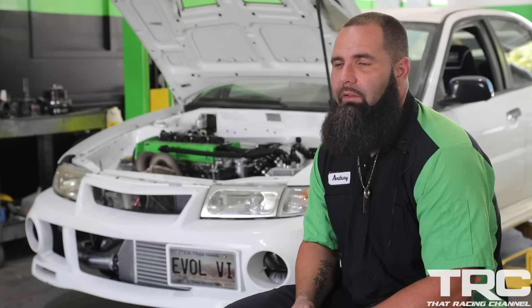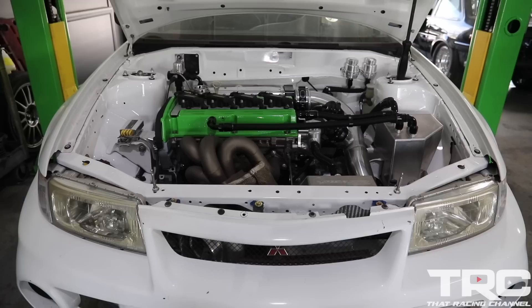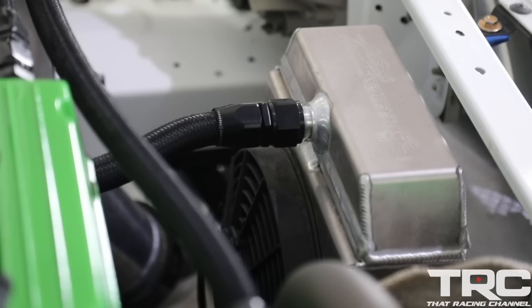We have a Magnus Racing lower rear subframe. I'm doing something a little custom on this car — I'm putting an Evo 8 transfer case in it. The Evo 4 through 6 upgraded parts they make for this car are known to not be very strong. So we're going to bypass all that and make a custom subframe to put an Evo 8 transfer case on the car — going with what we know instead of testing new stuff.